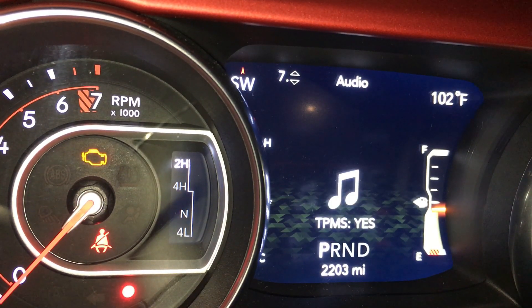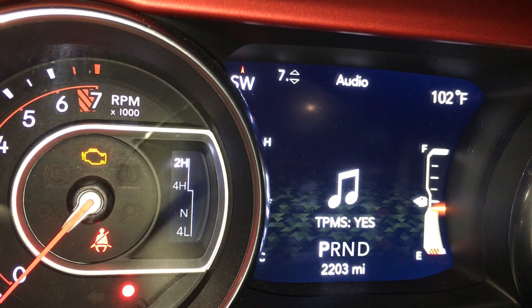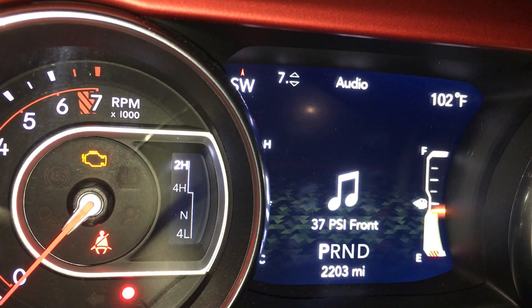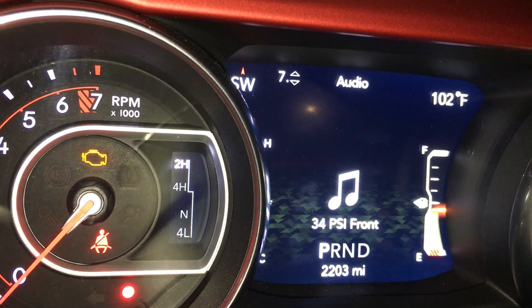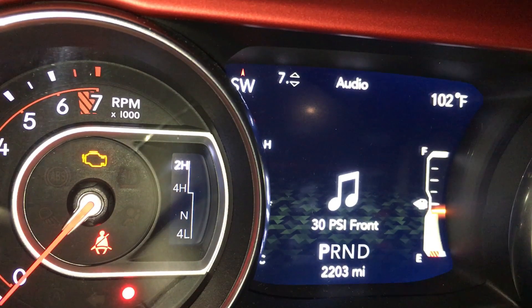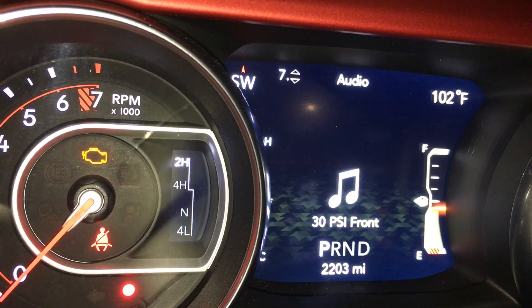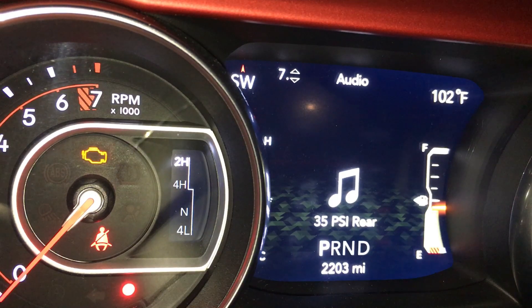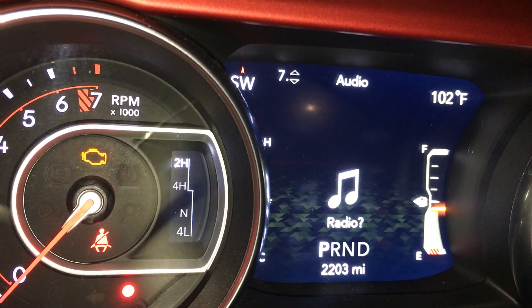Hit your cruise control on and off key in the center of your cruise control while holding the left arrow again. Then while holding the left arrow, hit the cancel button, and that will tell you what your PSI threshold is for the front. To adjust this, use your plus or minus to adjust this down — I'm going to drop this to 30. Since we're going to run these tires around 32 PSI, this will be a good threshold for a warning that the tires are getting low. Now I'll push the left arrow and the cancel key again, and this will give you the threshold for the rear. I'm going to hold the left arrow and then push the minus set key down to 30 in the rear. And now we're done.